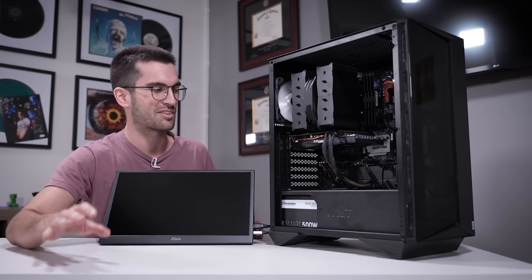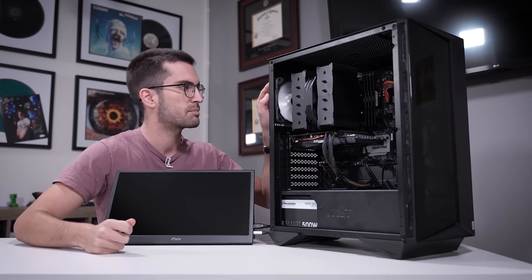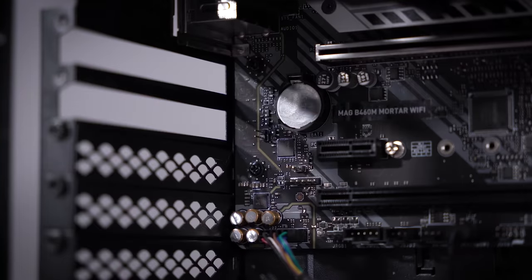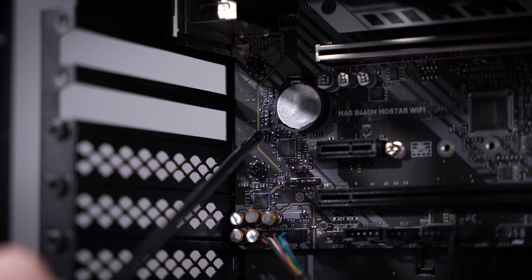So don't take it personally, we do this for everyone. Let's go ahead and power the system back off and clear the CMOS. We're going to have to jump pins because I don't see a button on the back of the board. The pins for clearing the CMOS are underneath the graphics card right here by the battery. We're going to jump these two pins with the power completely off for anywhere between 10 and 20 seconds. This will cut power to our BIOS chip, resetting settings there.